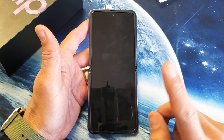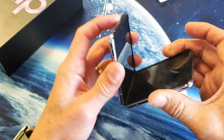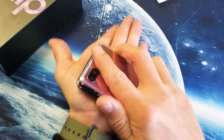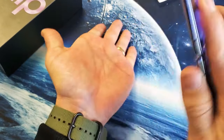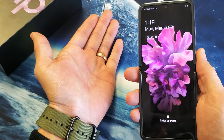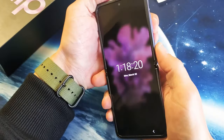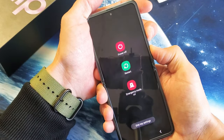If not, the last step is what I call the smack method. Close the phone and bang it right on your palm, then turn it over and bang it a few more times. Now open it up and bang it on the top side, then on the bottom as well. Do the same on the screen side — top and then bottom. Now go ahead and do a force restart: volume down and power button, press and hold both buttons. Do not let go until you see the Samsung logo.